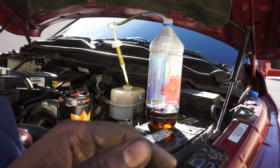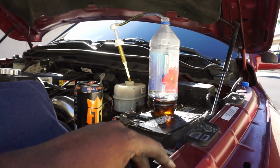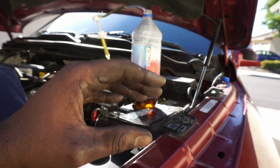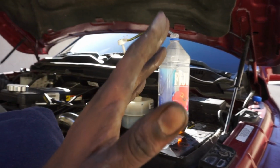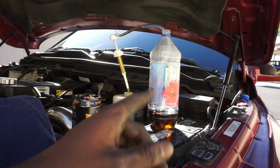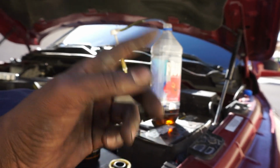That way, if you put new pads, rotors, hell, even calipers, and you bleed the brakes just enough to get the air out, but the pedal still feels spongy-ish, 9 times out of 10, you need to completely purge all the old brake fluid out and get some fresh fluid in there, because people don't understand it, but this stuff makes a world of difference when you have clean fluid versus dirty, gunked up fluid that's just been circling over and over again.